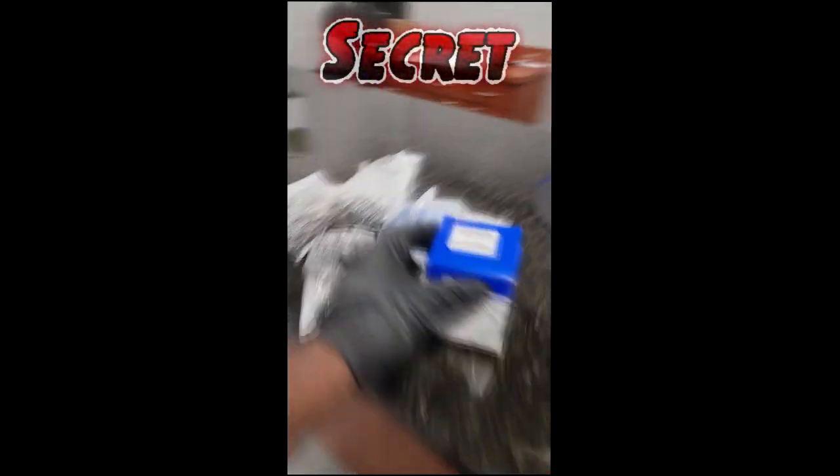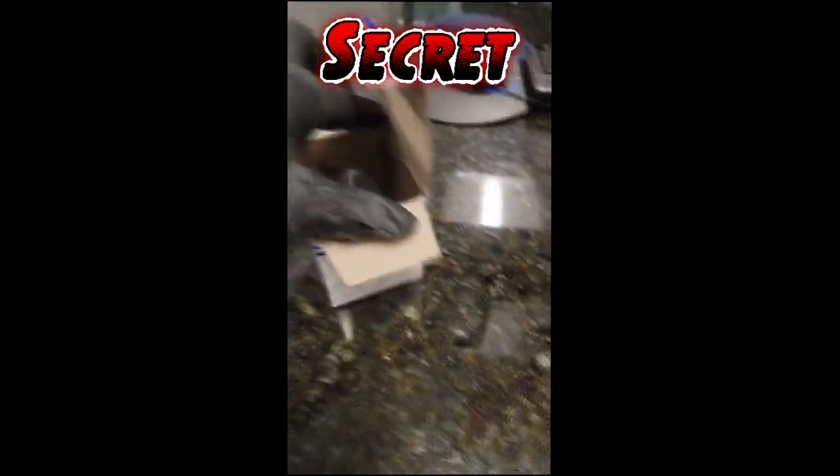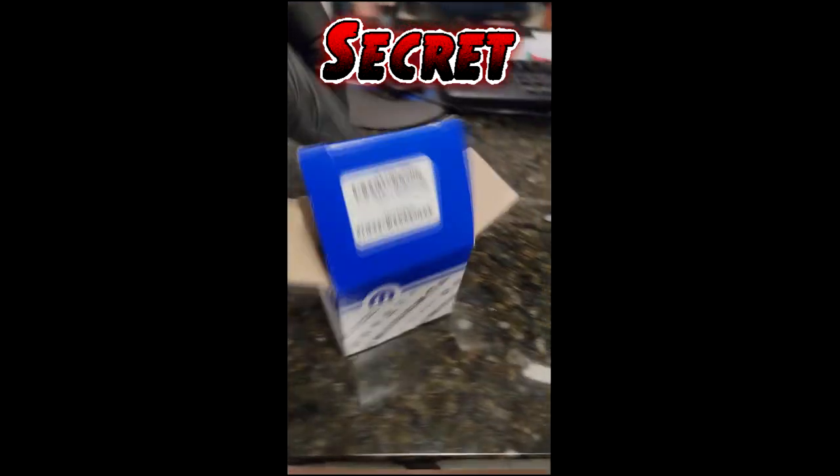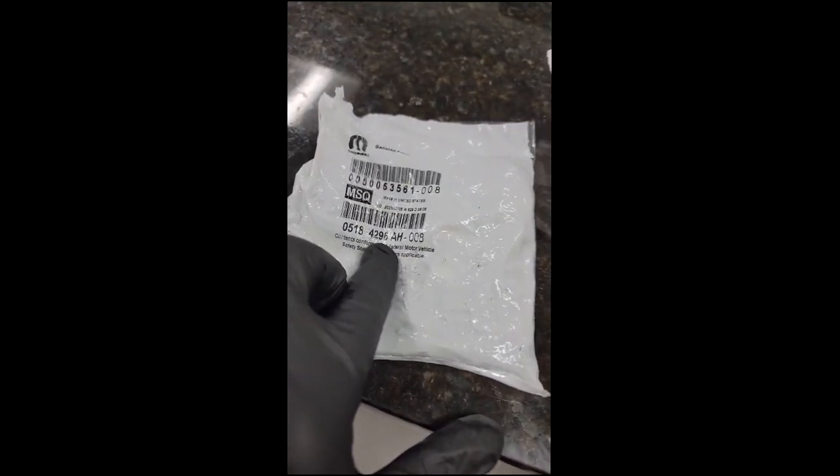I've got another 1K ticker job lining up for this weekend. This one's a 2011 Grand Cherokee — the first year the Pentastar came out on Grand Cherokees, and it has the old style rocker arms. My ticking issue is from the rocker arms, not the lifters. I would not waste my customer's money on 24 lifters. Based on the sound frequency I'm hearing, I think I can get away without new camshafts. So I got 24 rocker arms, a PCV valve, intake and intake seals. I got these parts from the dealer — OEM Mopar. I don't have any aftermarket rocker arms. My weekend is booked up — I've got a lot of work to do.